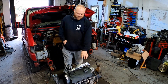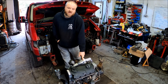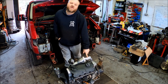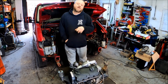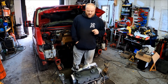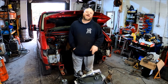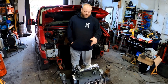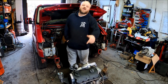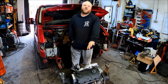This engine came out of an Audi A4. We've used the inlet from the Audi, and we've got one of these EGR delete pipes. We are using the outlet manifold from the original ABL because PD19s have the same head pattern, inlets and outlets as the ABL. So even if you wanted to, you could use the inlet manifold, turbo, and everything off the ABL — it will literally all bolt on directly.